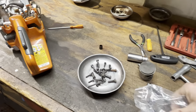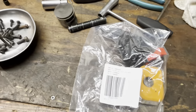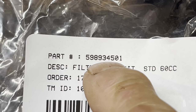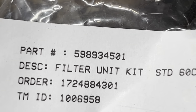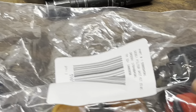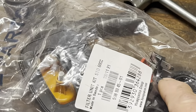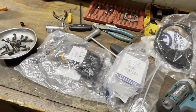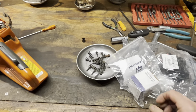This filter kit for the 562 does ten times better. The part number is 598 943 501, and this comes with the filter base and a filter, so we've got everything we need right there. You just have to hook up the kill switch wires and swap over the purge bulb. There's also a new carburation device that we'll have to program, and a brand new piston.